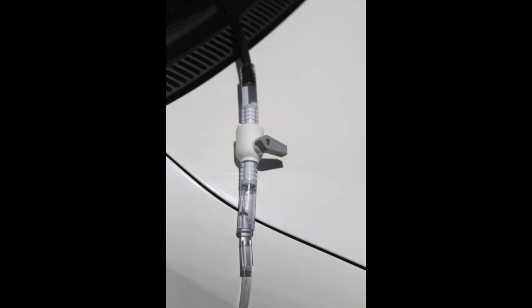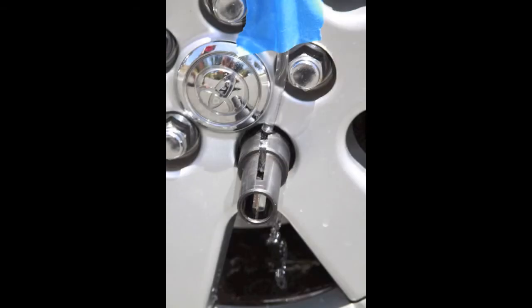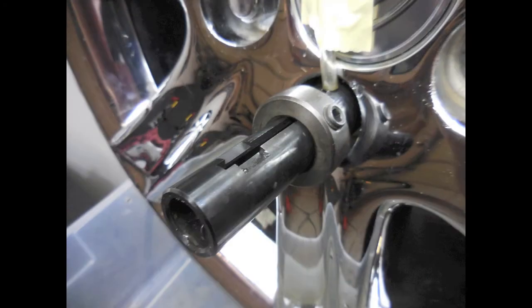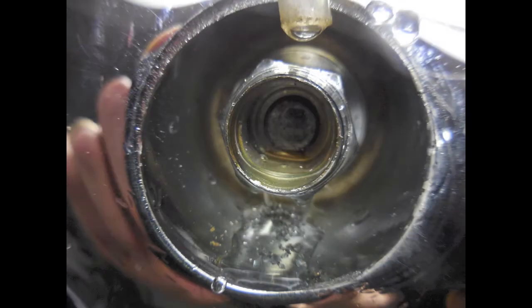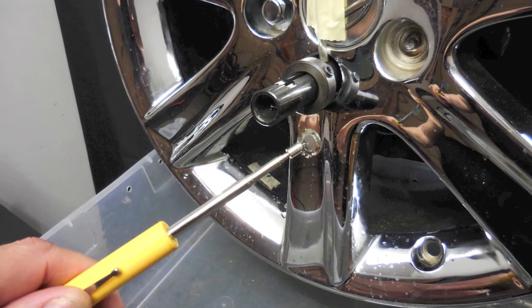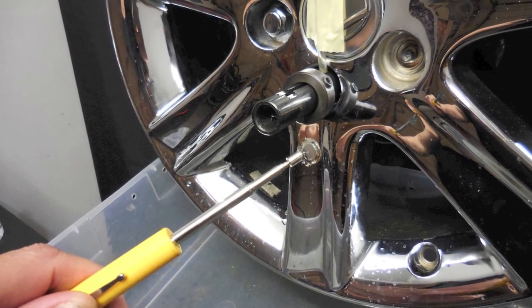With the water flowing, you can get it directed exactly where you need it — right through the top of the guide. Make sure the groove of the guide is facing up; this allows water to flow in through the top and shavings to exit through the bottom. Here's a picture showing how the head of the lug nut has been removed after the initial drilling start.